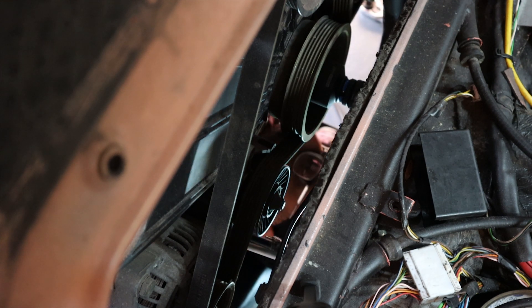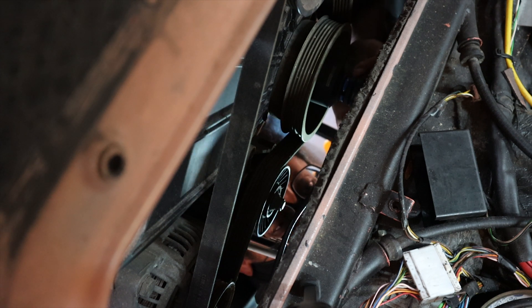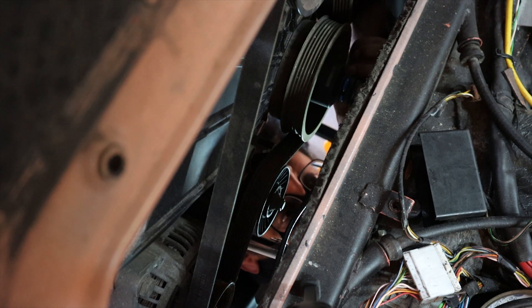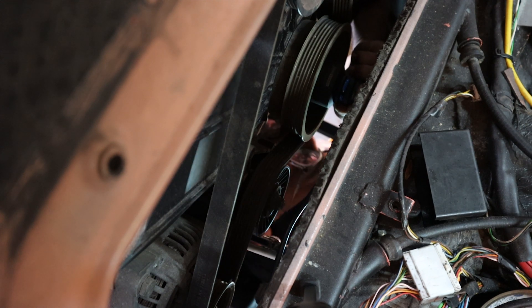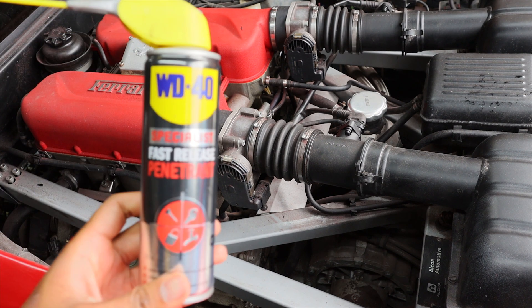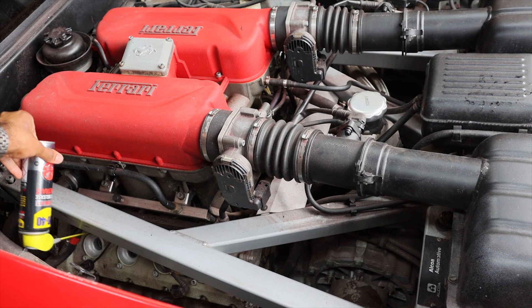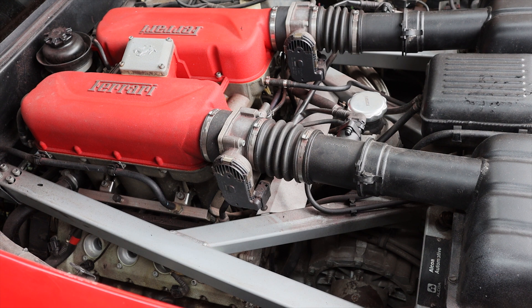I was using a small bar just because we haven't got the car that high. I've now attached the big breaker. I can only turn it a little bit because there are gearbox cables here. No, it seems a bit sticky. As it's a little more difficult to turn than we'd like — thinking the engine has been sat for a while and things might have started to stick — we're going to take some penetrating fluid and put it down in the spark plug wells, all eight of them, to give the pistons a bit of lubricant and hopefully help things move more freely.